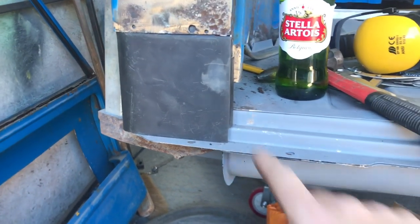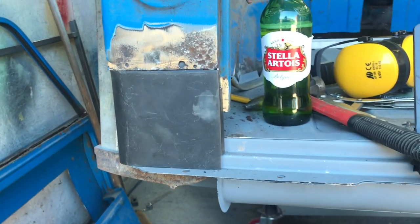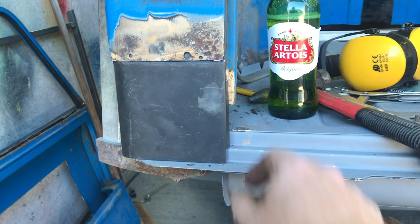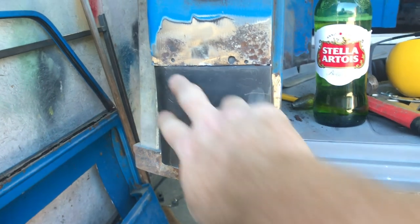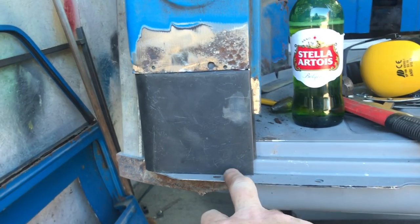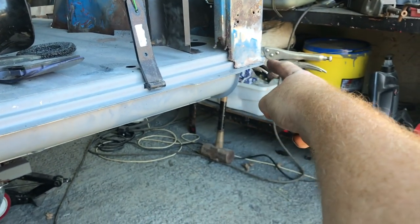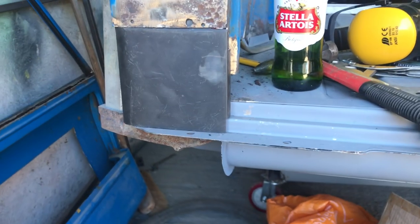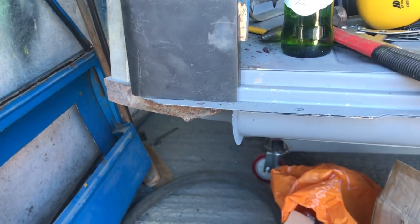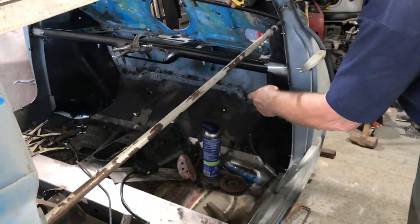While Dad's sorting out the front floors, just working on this little Magnum repair panel. A bit pitted up here, could do with being higher but it is what it is. The curvature's not quite right so it's not sitting right - just need to trim it a little bit, put a flange on there. Basically keeping the old one as a guide because it's still got a flange on it, so we've got dimensions. Always work with the worst side first - you've got the good side to then work off.